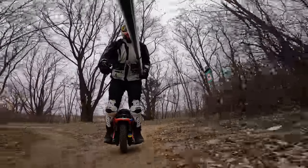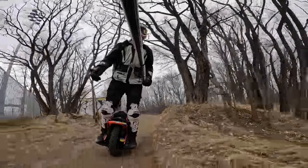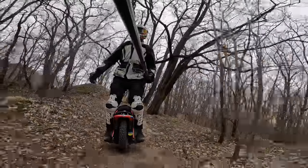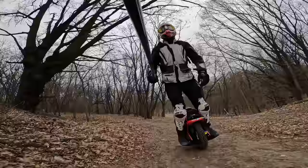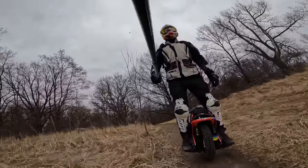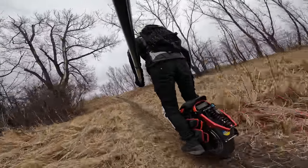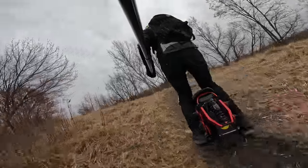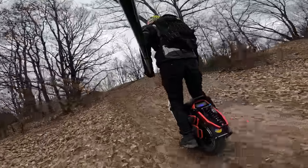Moving on to a bit of an off-road MTB trail — the suspension works pretty well in those cases, and if you don't lean too much the pedals won't clip. The suspension definitely helps out a lot with drops and roots and other obstacles. However, this wheel doesn't feel like a high-torque wheel at all. It feels like you need a lot more leverage and lean to achieve the same thing as on the RS HD or the Commander HT — it doesn't feel zippy. Even the 16X is so much more fun off-road for technical or harder off-road trails.